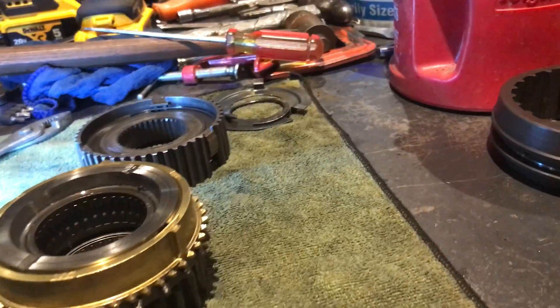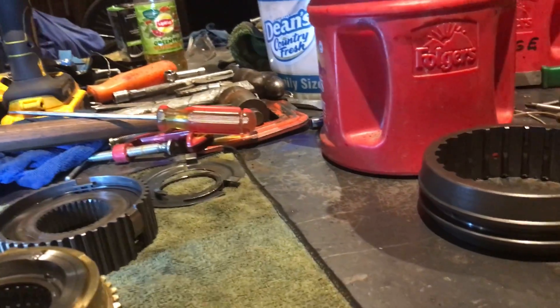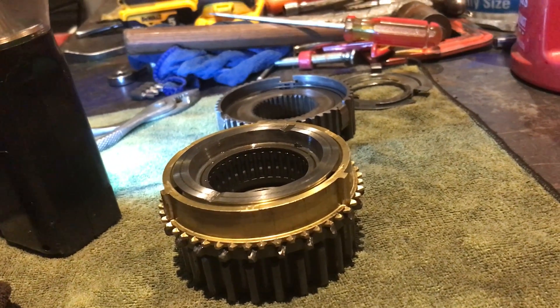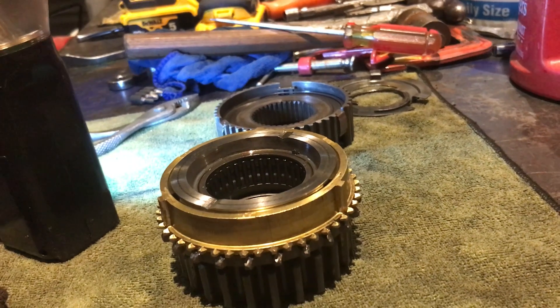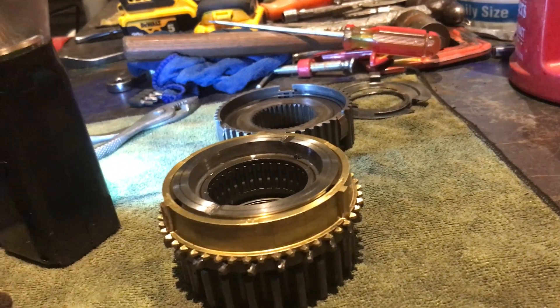So I was going down the road and it pretty much just went into neutral by itself. But when I tried to tow it, it would kick back into gear or something. I was in 2-High, and obviously if you just put it right back into 2-High while going down the road, the back wheels would lock up — so that was the problem.